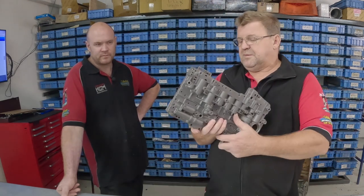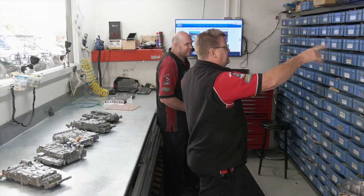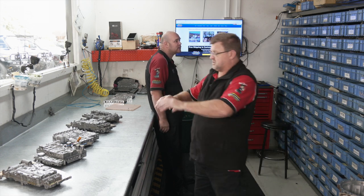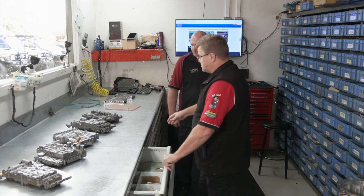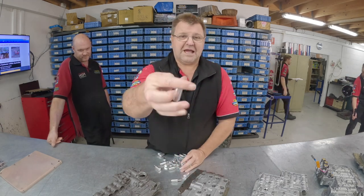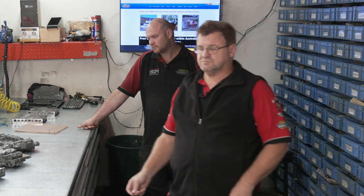That's what they look like finished — they go out with all pan gaskets, valve body oil filters, and fitting instructions. Behind us we have all the shells — returned valve bodies. There are about 200 in rotation at any given time. We strip them out, totally remanufacture the valve body, change the valves, change the springs, put in our new separator plates. For the Ford Ranger specifically, we fit a thermal bypass valve — we have them by the thousands, they're that popular.